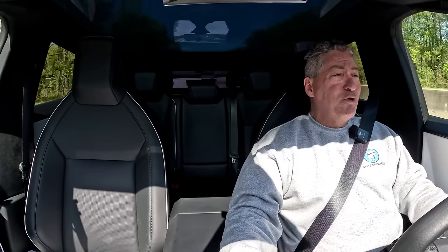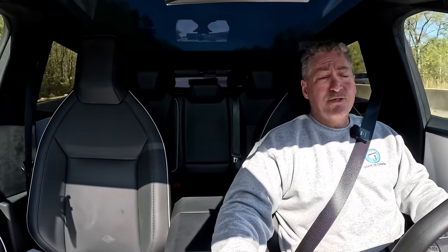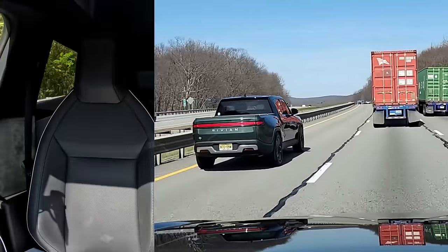223 miles after 75% of the battery is pretty good — we're still tracking really close to 300 miles. I hope we get it, but we get what we get. I don't root for the cars when I do these range tests; I just try to be as fair and honest as possible. We did the Lightning range test — I think I finished around 270 — and the R1T only 254, but that was drizzling and cold, in the low 40s. Today we hit a high of 66 degrees, so it's great range weather.